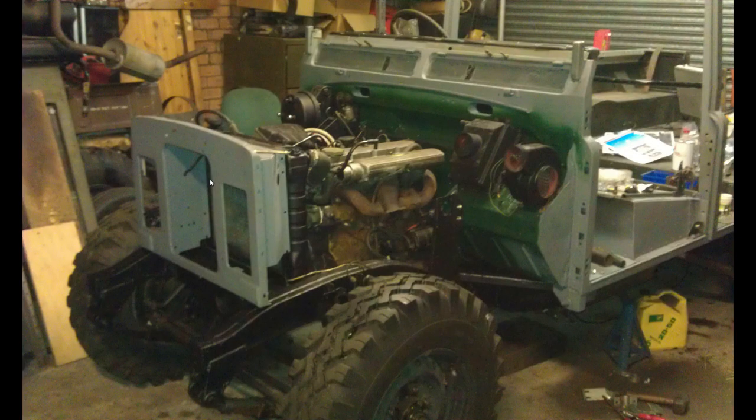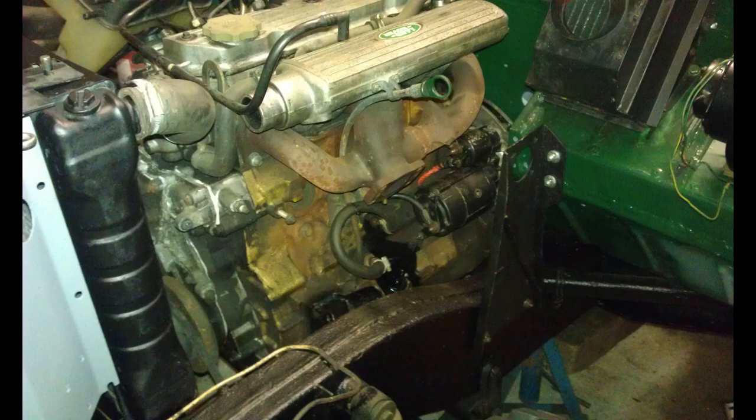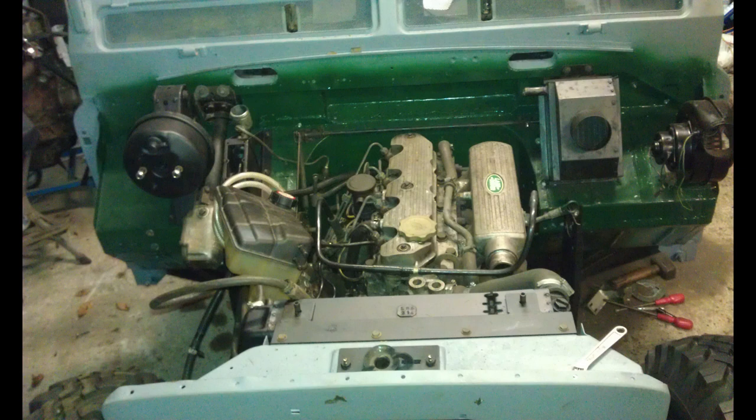So there's the front grille now with the radiator mounted. Things are starting to come into place, and this is the plate that I made for the top of the radiator mount — just a piece of 2mm bar. I added these two little lobes, drilled a hole, lined them up, bolted it on, and it held the radiator in place. I also needed a water tank for the radiator — that was taken from an old Ford Mondeo that I had stripped down. It seemed too good to throw away, so I repurposed it and it found a home there.